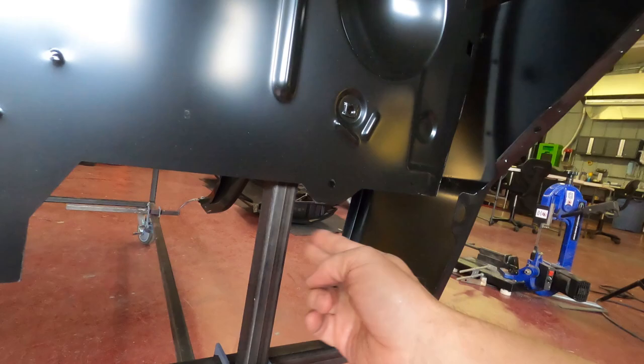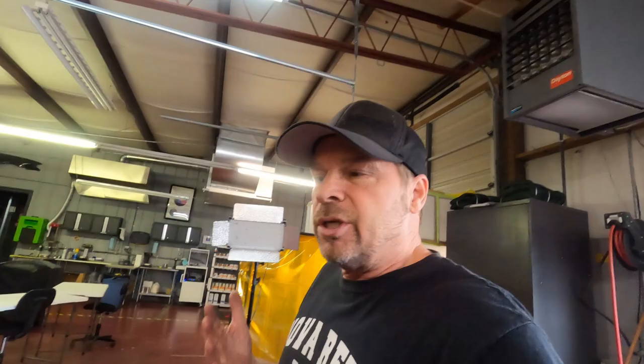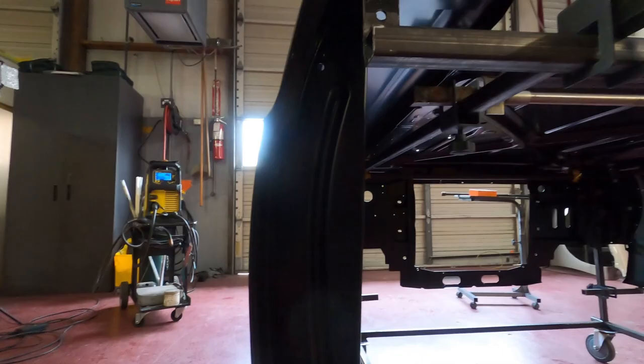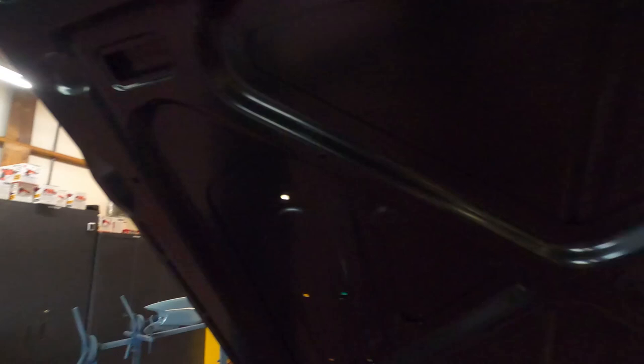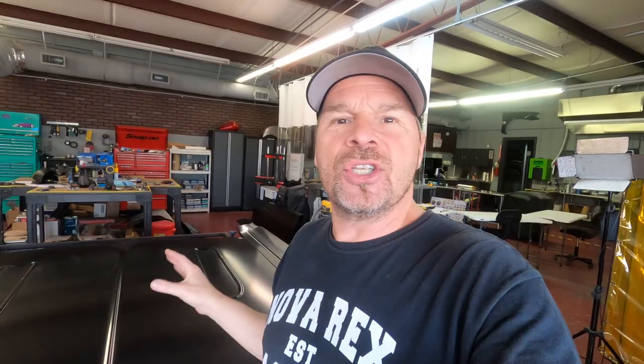This is just square tubing — the same square tubing I used for the big box construction. Pretty simple, pretty straightforward. It doesn't have to be complicated. This stand in your shop gives you the opportunity to spray your vehicle in chunks but still as an assembly — a really nice convenience. If you've ever noticed a dry overspray line behind panels, on this stand I can spray all the back areas and get a nice wet edge in all the crevices, including under the hood with the hood still attached, and spray the outside at the same time. What a time saver.